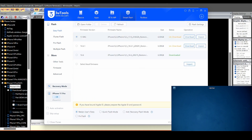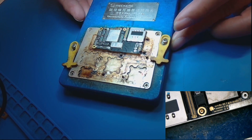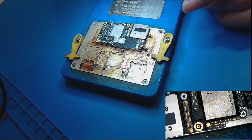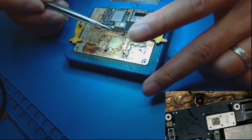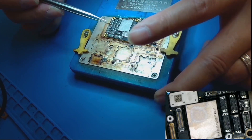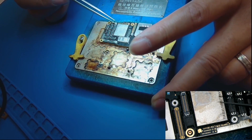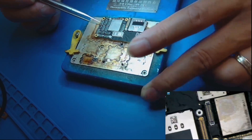It's not a CPU issue — looks like this one was dropped. It's boot looping and stuck in recovery mode. When you drop a phone, some connections may come loose within the pins. Basically, the way to fix it is to remove the logic board and then reseat it again. So this is what we're doing — it's been almost 10 minutes, let's turn it off and let it cool down, then we'll put it back on the phone and see if it boots up normally, and then we can restore the software from there.